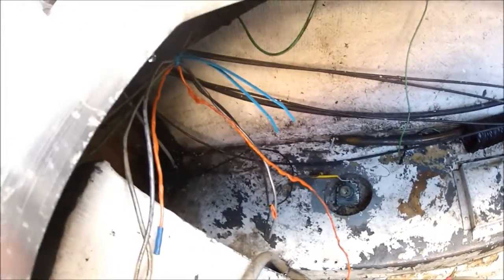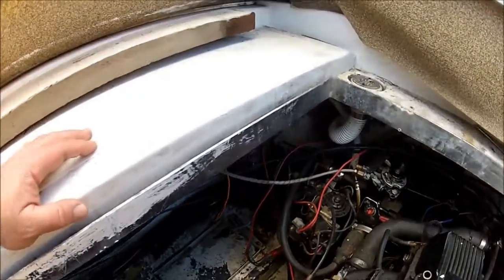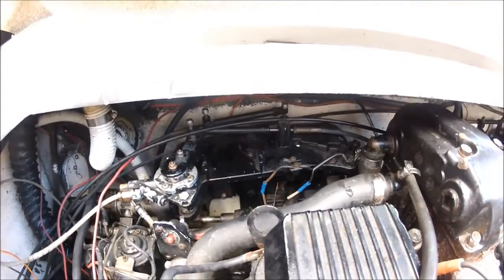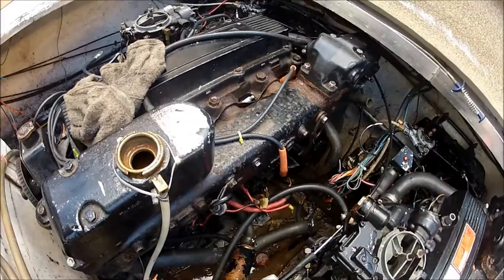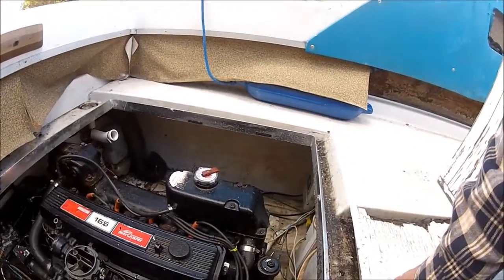You can look at this wire here — it has been so overheated. The insulation is just melting off of it. I'm going to spend a lot of time on wiring here once we get everything back together. Like the shift cutout switch — the wiring wasn't even there. There are just splices everywhere, and you can see that the fuse there has been overheated. Just a lot, a lot of cleanup work is going to have to take place here.